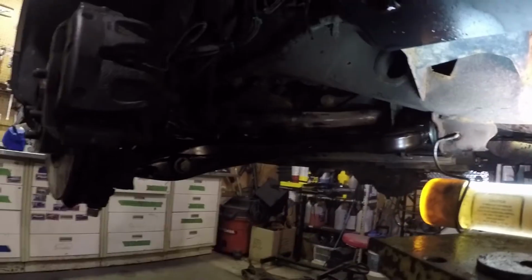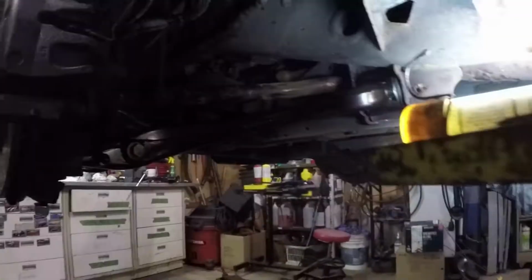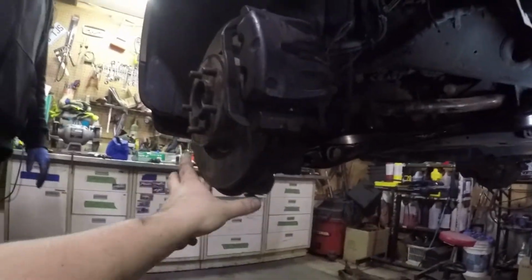I put that washer back in the back here. Yep. I think so. Yeah, so there's a washer on each side, so we have to make sure that from the side where you don't see the angle adjustment, you need to make sure that you have the washer there. So let's tighten the suspension, let's tighten the lower ball joint, and once all of that is tight, we need to do the outside first. Once the outside is tight, because none of it is actually adjustable, then the inside is what we're going to finish with.